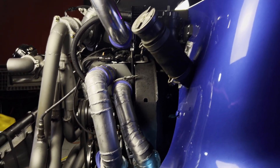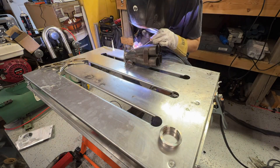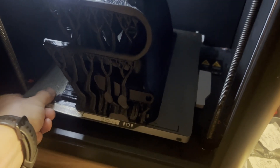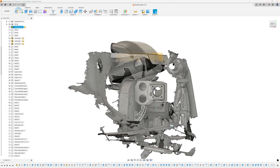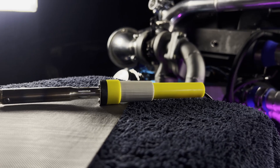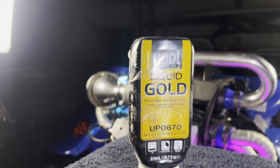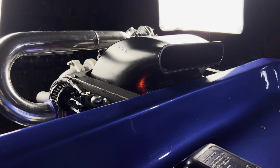If saving time and money is cool, this next part literally cools hot air. Part number four: Ram Air Duct. In a rear engine car like this, everything behind the deck lid is just cooking all the time. So instead of relocating my charge air cooler forward in the vehicle with hours of TIG work and hundreds of dollars in tubing, I printed a custom Ram Air Duct that sits right above the deck lid and forces air down and through the intercooler. A quick handheld scan captures the deck lid area, and then in CAD I split the model duct into two ASA shells large enough to print on a standard bed. The halves get plastic welded together and a veil of fiberglass mesh is added inside for extra support, followed by a quick skim of filler, then a VHT paint. ASA plus VHT paint could care less about 250-degree pre-intercooler temps. 60 minutes of labor and $31 is a bargain compared to half a day of welding and $300 in tubing.